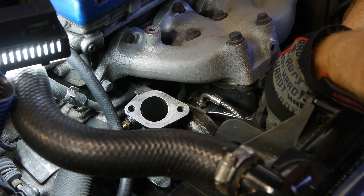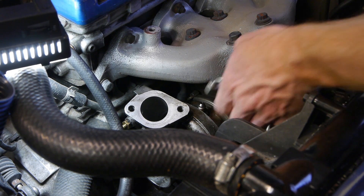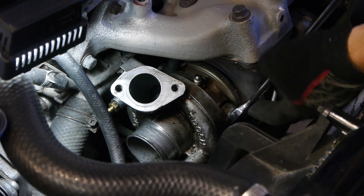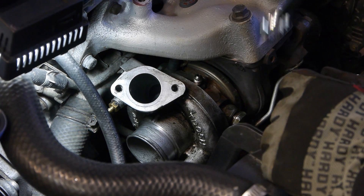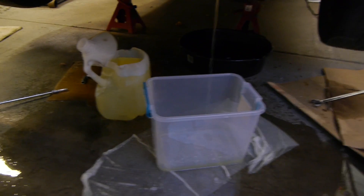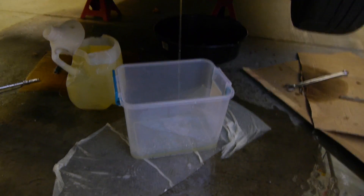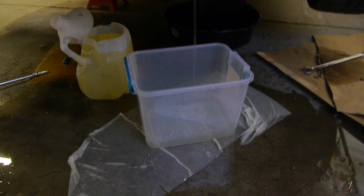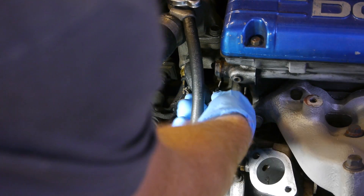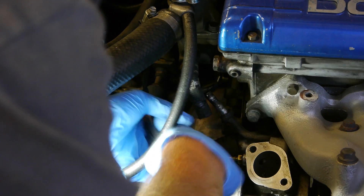While we're on oil connections, we might as well get the oil feed line next. And then we'll start getting the water lines. And if you're smarter than I am, you'll drain your coolant before you start on the water lines. Better get a bucket. And remember what I said about being smart? Yeah, that's not me. I might have spilled just a little bit, but let's keep disconnecting stuff. Let's disconnect the coolant feed next. Mine was pretty jammed on there, so I needed to cut a little off the end first.